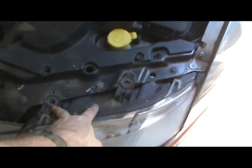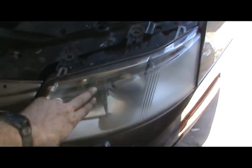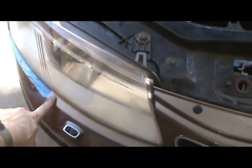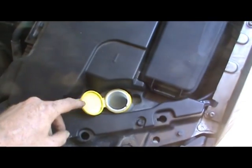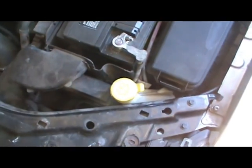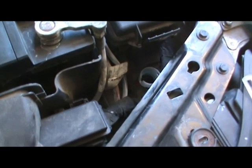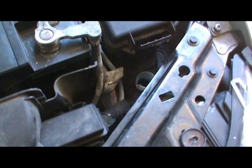The sob story continues. I started disassembling this and thought it'd be noteworthy to fire up the camera. I've got foggy and leaky headlight lenses — they're getting moisture on the inside. I also need to address a leak in the windshield washer reservoir. I think all it is is an o-ring that fits in there. Somebody's put Permatex on it trying to stop that leak. I'm going to try to get that leak fixed and get the headlights good and clear for the new owner.